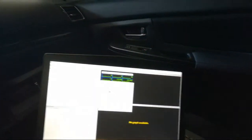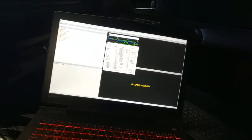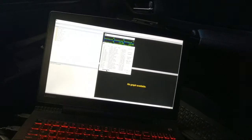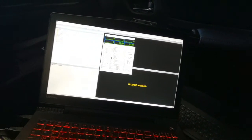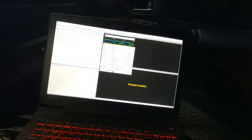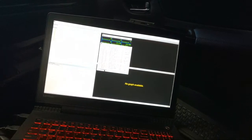Throttle position. Targets, I don't care about that. I don't care about that. These things aren't going to affect what we're doing here. Ooh. I do want this one though. And well, we'll do that one too. Why not? It won't hurt. Airflow. Let's see. Both intake temps. Ignition timing. Don't care about fuel pressures for this. It doesn't matter. That there does matter. We'll throw some knock at it. Let's see, make sure we get some of those. Barometric. Don't care.